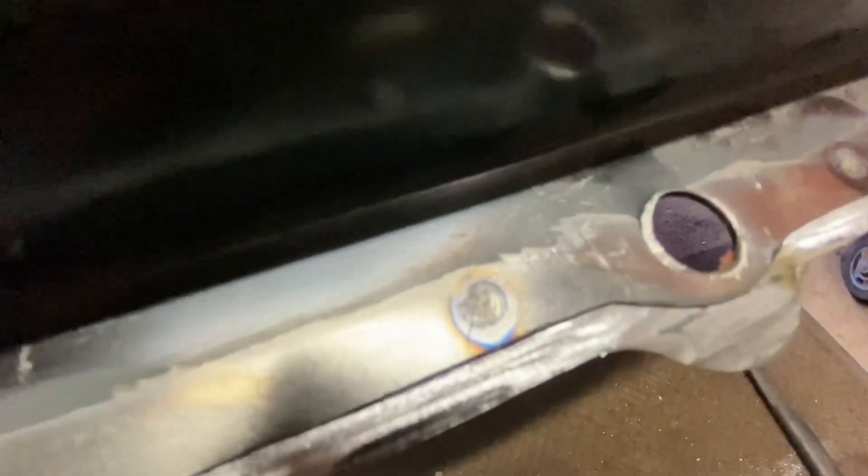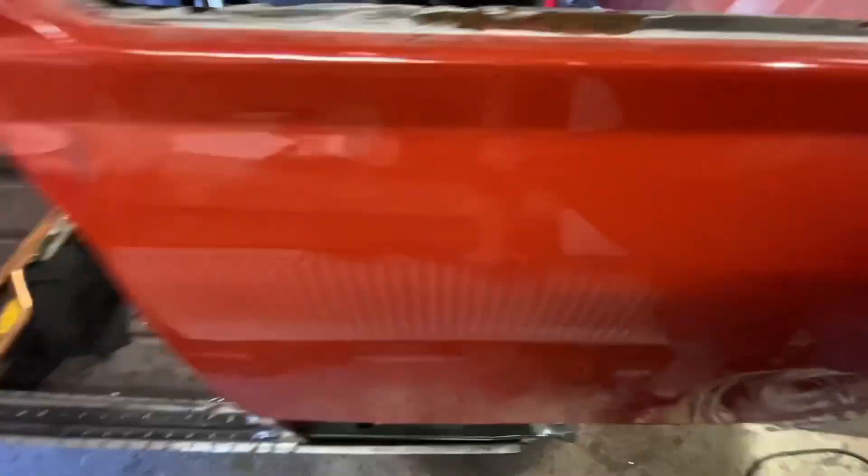Great, that lines up — one spot weld, two, three. That hole lines up — four spot welds, that hole lines up. And we've got a little tap there, a little tap there. Then if we come round, I'll put my string line across the two centre points of the bins. Then I measured from there to there — 181 there, 181 there. And we've also got three spot welds holding it to the floor and two V-clamps, so more ribs, and the thing's just gone tight.